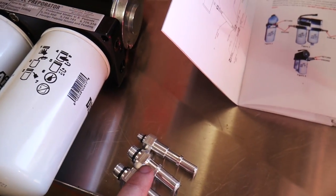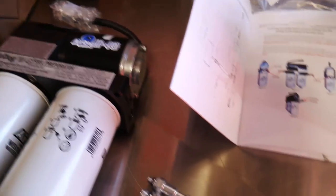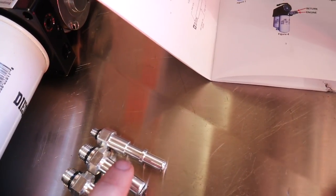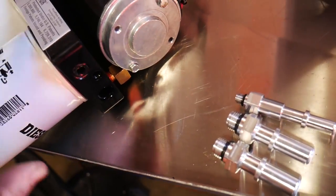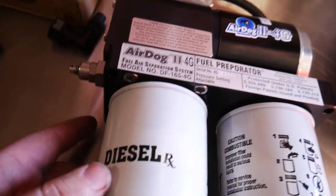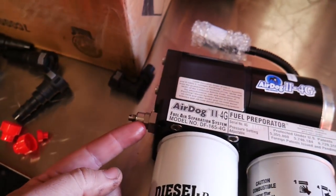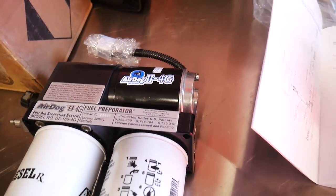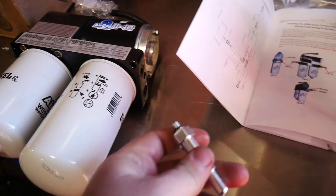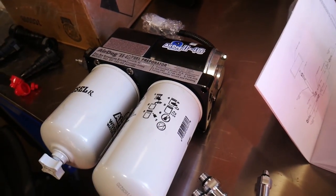We've got our fittings that we're gonna pre-place into the AirDog before we get it up onto the bracket. We've got two of the larger fittings — you've got the in, the out, and the smallest of the fittings is gonna be our return. On this side the smallest fitting in the middle is our return going up to the front, and the bigger one in the back is coming to our feed. The adjustable pressure is right here. We'll have all of our fittings done ahead of time. They do come with nice O-rings already placed on them — aluminum machine fittings. We're gonna put a little bit of thread sealer on there and get those on so we can mount everything up into the bracket before we get the bracket onto the frame.